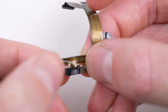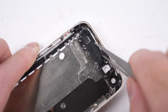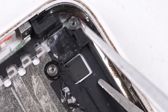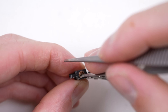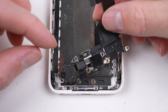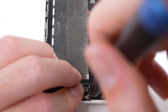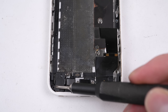With the cable modified, it's time to get this upgraded 5C assembled. I'll use the SE antenna to avoid any unnecessary signal issues. It fits right into place after the two existing alignment posts are broken off. It's also a good opportunity to clean the charge port before it's installed, as it's easy to clean with it outside of the device. Thankfully, the screw holes line up, with the exception of one for the headphone jack - it's a good 4 or 5mm out, so we'll just have to miss that one. But I'm surprised that this is actually coming together.